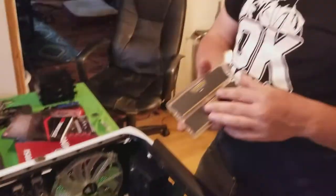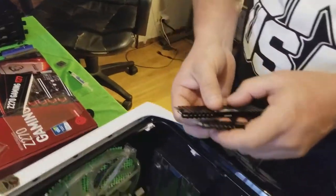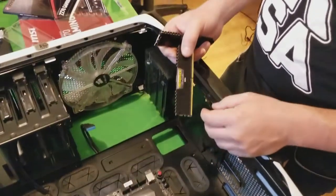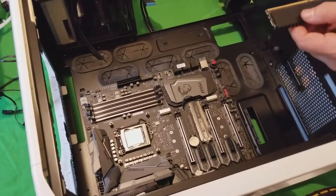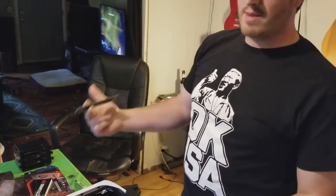This is RAM — random access memory. It's used as random access memory, believe it or not. Every motherboard has their own little special way of handling this. This is dual channel and you have to put it in right — in this motherboard it is in channels 2 and 4. If you put them in the wrong ones sometimes it won't activate the dual-channel mode that makes it perform better. When you put stuff in a computer you want to make it go as fast as possible — more better, less worse at all times.